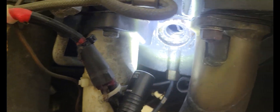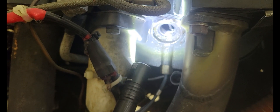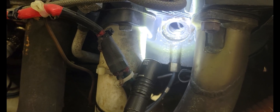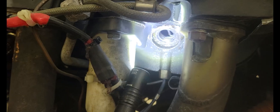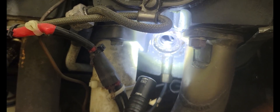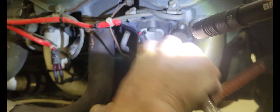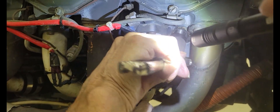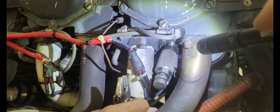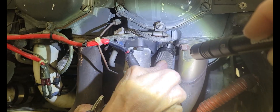It took a minute — the helicoils didn't want to cooperate so I had to use the second one, but that helicoil is in there now. We've got to get rid of the tang and stake the helicoil in place. This tool has gone in there and staked the coil, and when it gets loosened up we should be able to put a spark plug in here — though I think you still have to face off the seat first.